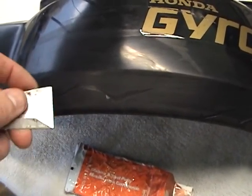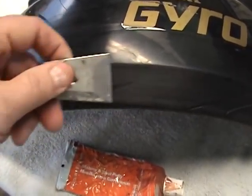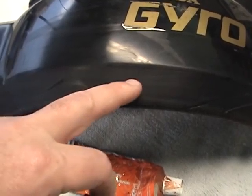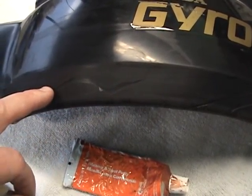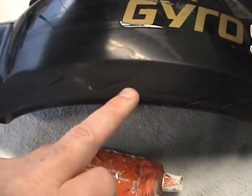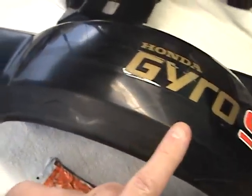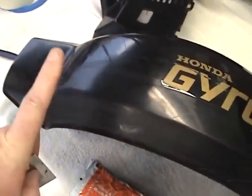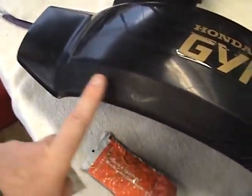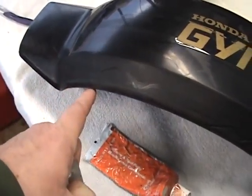The reason we want to just fill in this area is because as you're sanding with that sandpaper, you're taking this area down and also the area where the scratch is. So you want to do as little sanding on the original flat areas as possible. You don't want to create a huge hump with spot putty and then have to sand it down, which also lowers all the surrounding area.